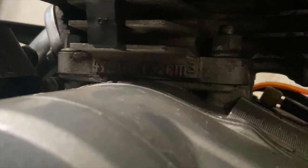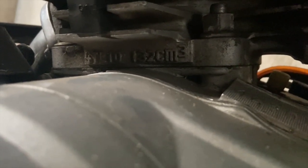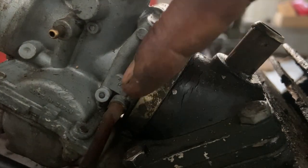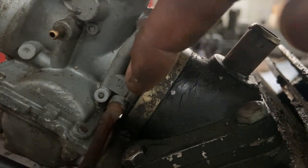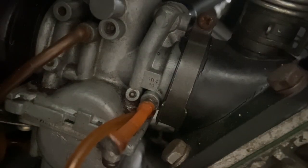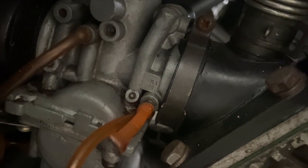Now for the 5-speed — as you can see, it says 4TL-10. That is the RX135 5-speed cylinder kit. The carburetor in the RX135 4-speed says 4TL-01 — that's how you identify a 4-speed carburetor. The RX135 5-speed carburetor says 4TL-20.